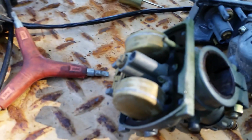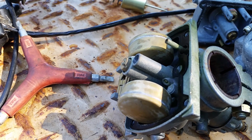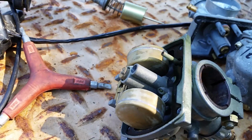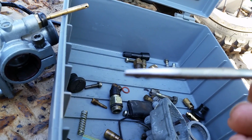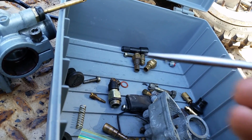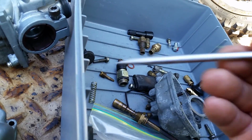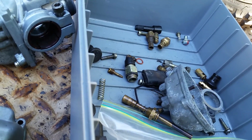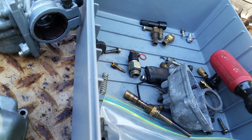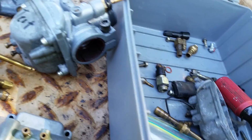You're going to want to spray some lubricant in there prior to that, though, to penetrate. So you're going to have a couple things going for you. You're going to be cutting into your groove with a better screwdriver. You're going to be impacting it, same way you take off the screws here. The impact right there will shock it loose. And if it doesn't work, simply do it longer.